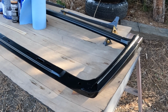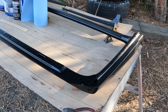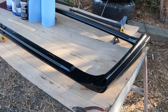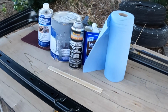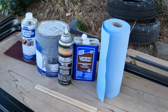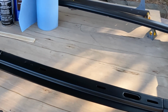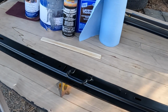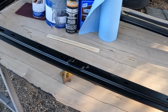And then there's another one that's an actual coating that is a rust preventative and such, and it's a much higher quality coating. The difference between the two, in other words, how to tell between the two, is to use lacquer thinner. Put some on a paper towel, rub it into the black very gently, but very consistently as well. Then you pull the towel up and check to see if it's clean. And if it is, it's the good quality primer.